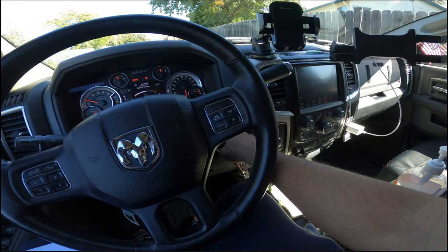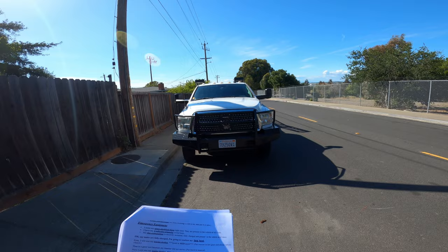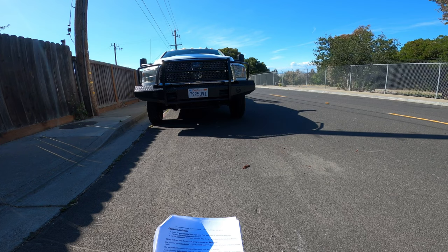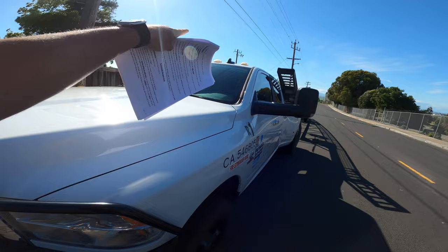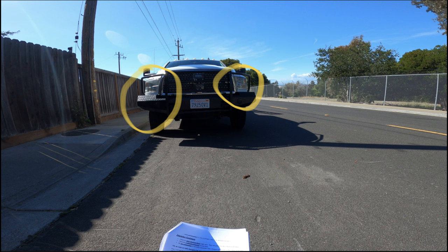Tell the examiner 'can you assist me outside.' Say: 'I'm going to check that my tractor is not leaning to the left or right, there's no puddle of oil or coolant fluid on the ground, I will check there are no people, vehicles, objects, or obstructions behind me before I move.' Check marker lights and reflectors on top, side lens, front and back — marker lights should be amber in the front, red in the back. Point at headlights, high beams, and turn signals — 'clean and clear, not cracked, damaged, or broken, securely mounted and working at all times.'